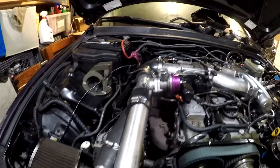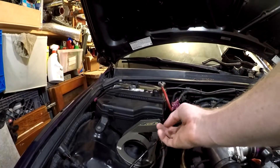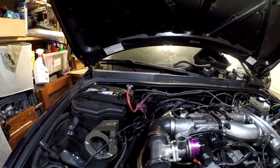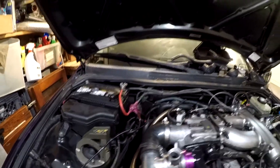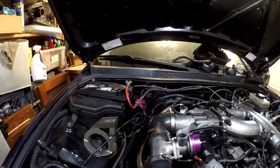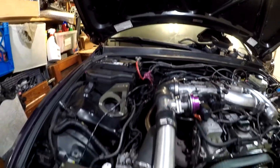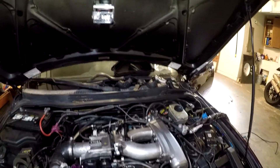The mass airflow sensor wires are down here now. They actually run back, and that wire going all the way back is kind of zip-tied to the strut mount area — the strut bar is off right now. These MAF wires go back: three go to the ECU, one is power, one is ground — five total. They don't run along the top of the head anymore; they just go back by themselves to the rear firewall.